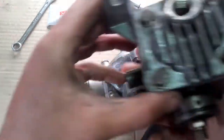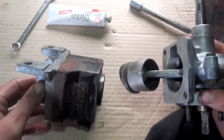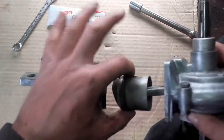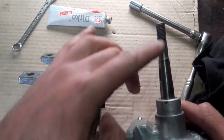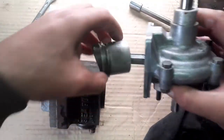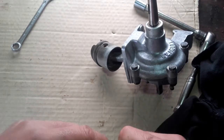So that is ready now for the block. There is my head put back on - I have done a video on how to remove the studs and get your head gasket back on and how to reuse it. This needs to be painted up before I put it back together. The exhaust port is here and this is where our water runs up. Our piston will be going back in like that - remember the tapered side is on your exhaust side and the longer end is the top end. I will do another video on the piston and rings and maybe the conrod as well. I will also be doing a block assembly video. Like and subscribe and thanks for watching.